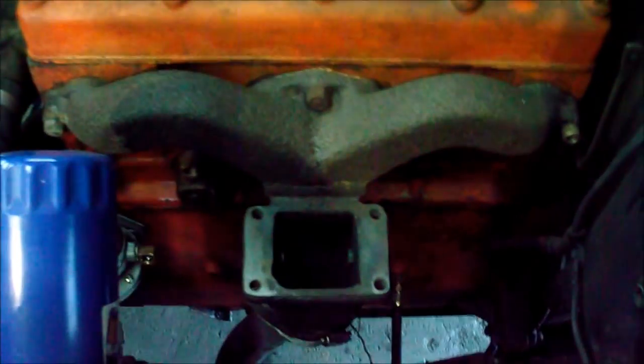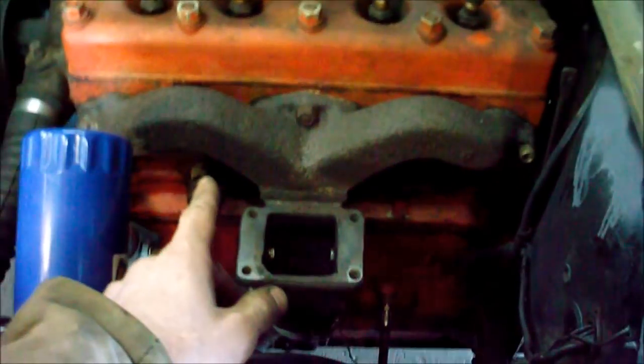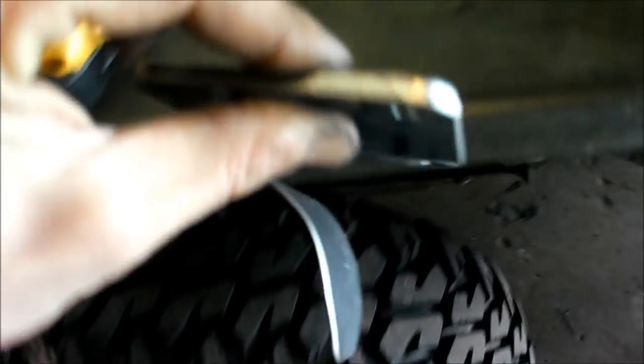That means less power. I'm going to separate them. I was thinking first about making a new exhaust, but I decided not to because it's harder, and if I make it out of tubing there's only one bolt holding the side edges on - there's two or three in the middle but only one on the outside edges, so that's prone to leaking. Also, running it down would mean I couldn't get to the valve adjustment without taking everything off. So I'm just going to block off this passage - I made a block-off plate and routed it down a little bit with a deflector to make it flow smoother.